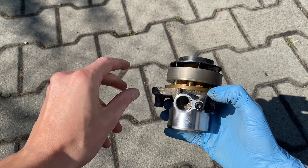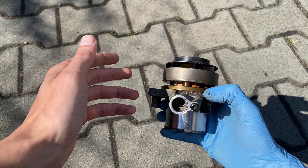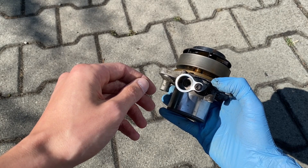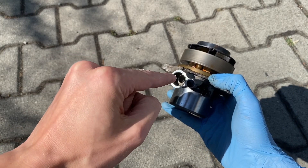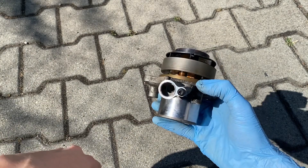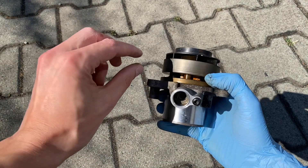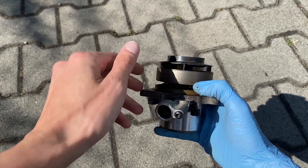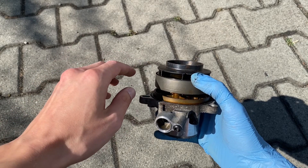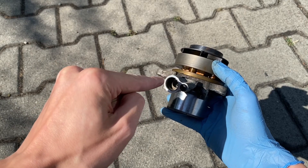When you are replacing your water pump, you can consider replacing it with a different design - one with no shutter. You'll have a pump that permanently pumps your coolant. The engine control module still sends the signal to the solenoid, but the solenoid won't do anything. The aftermarket pump simply doesn't have this shutter, so it pumps coolant 100% of the time.